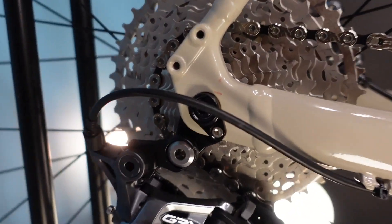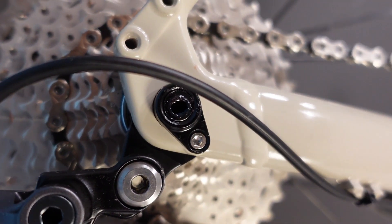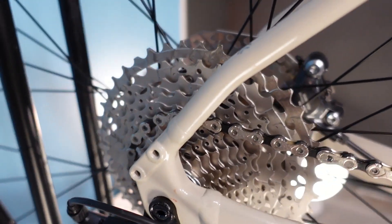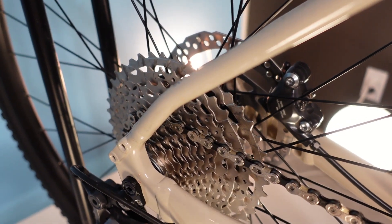As we look at the back of the bike, this is a through axle frame, meaning a 12mm axle, and it is going to help tie the frame to the hub in a way that gives a little bit more torsional stiffness and strength to the frame.